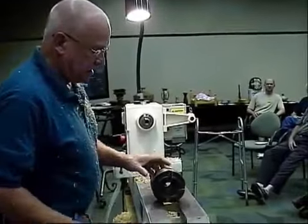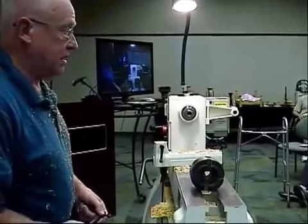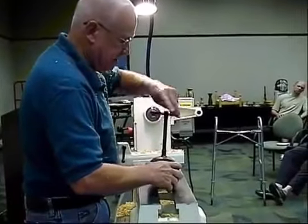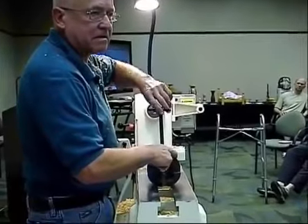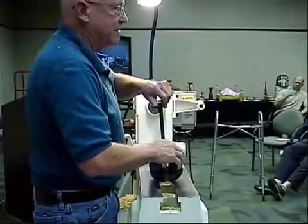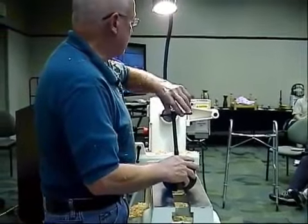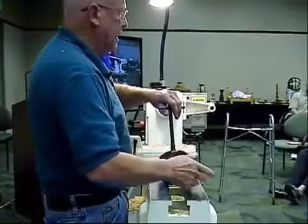If you'll just talk to one way and just buy these little slide things. See this little deal here? Just buy these. They're like 10 or 12 bucks a piece. And then you just take this and pull them out and just slide them back in and out. You've got to make sure you do it right, but you won't do it wrong but one time. They're marked 1, 2, 3, 4. Just line up your worm gear and stick them back in.